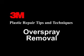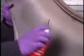Additional tips and techniques. On the back side of the bumper, it is critical that all paint overspray be removed from the area where the patch will be placed. This paint overspray has a weak bond to the bumper plastic and can lift off easily if not removed. We recommend the maroon Scotch-Brite pad with general purpose adhesive cleaner.